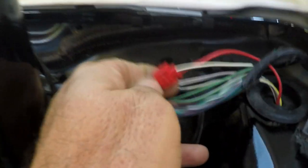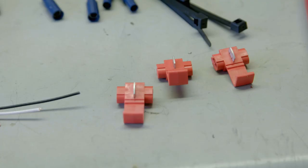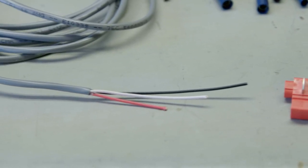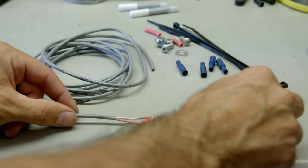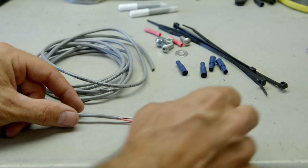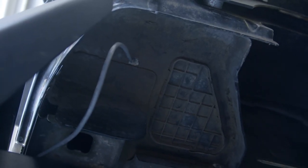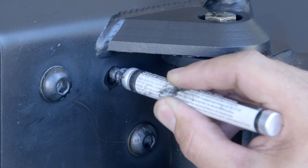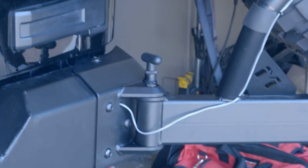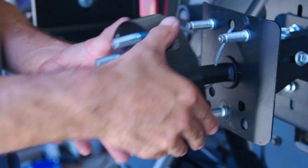The instructions are pretty clear on what wire connects to what. Here's a quick tip: when prepping the wire loom that comes with the mounting kit, stagger your cuts so that the plastic splice connectors don't make a giant blob in the harness. Then route the wire out to the rear bumper — here's the path I took: down into the rear tail light housing, out the foam under the tub, over the frame rail, and through a hole I drilled into the rear bumper near the pivot.